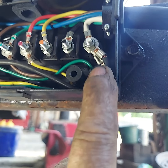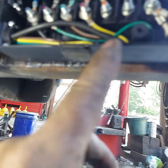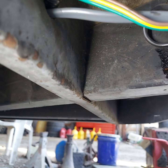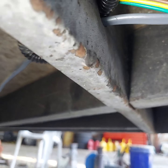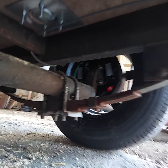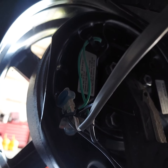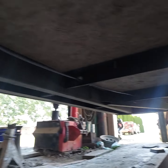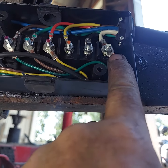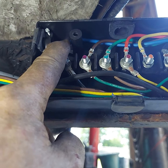I always put a separate screw to the frame right to the ground wire and run it right up to there. Your other wire hooked to the ground goes back in this two-wire harness for the brakes — just for the brakes. That goes back to here on the left side, which is usually always on the left side where your power feed comes back for your electric brakes.